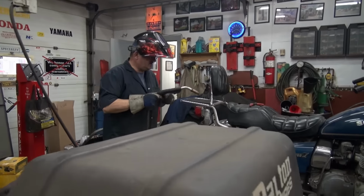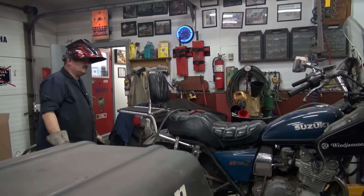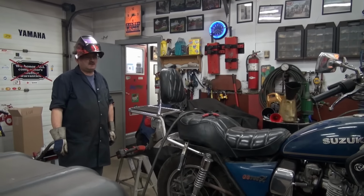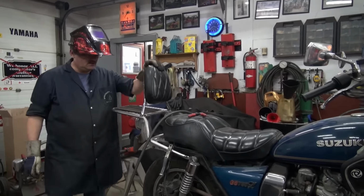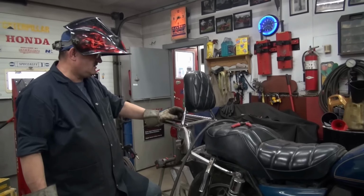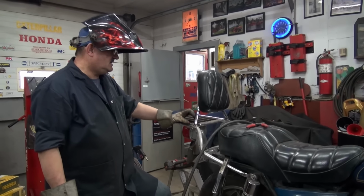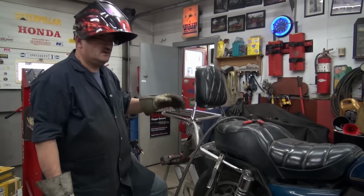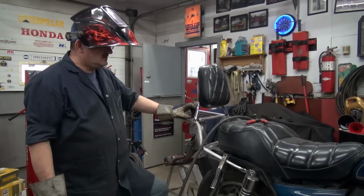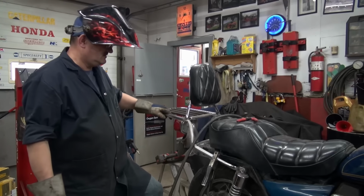Put a gusset on it, because we all come in different weights and different sizes. I suppose it's leaning back, pushing back. You don't want that cracking off. Your weight sometimes, as you're trying to get yourself seated there. So I'm going to make up a little plate to go here. Let me put a couple of slots in the plate itself, make it look a little bit better, and then I know it's safe.